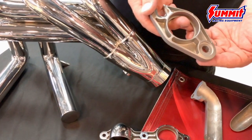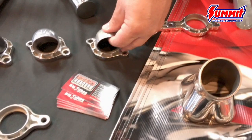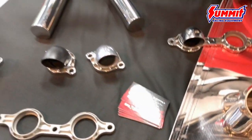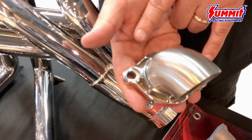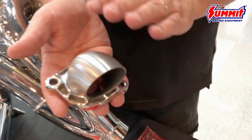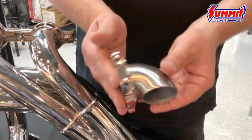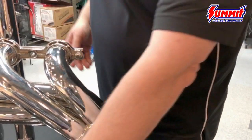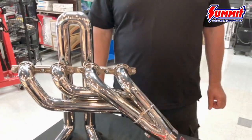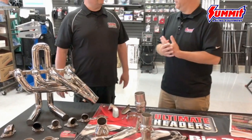In the Ford Coyote, this is an individual piece. And another one I brought along today is a Ford Windsor — there are some cylinder heads that offer a three-inch wide bolt spacing, so you can offer inch and seven-eighths for the higher horsepower engines out of those Ford Windsor engines, again with our cast elbow. So you're running the gamut from the more traditional old school engines all the way to the cutting edge — the Gen 5 LT and the Coyote.